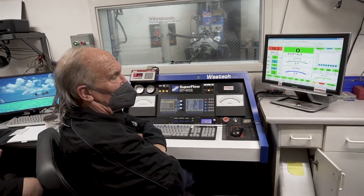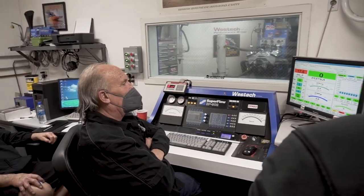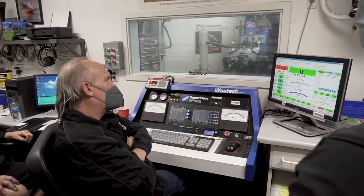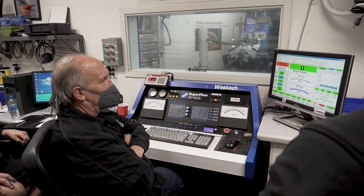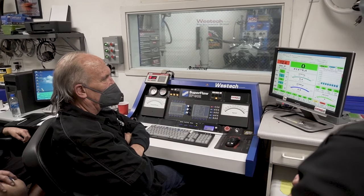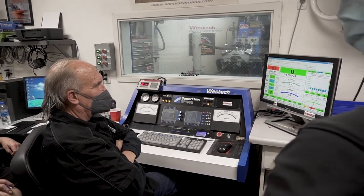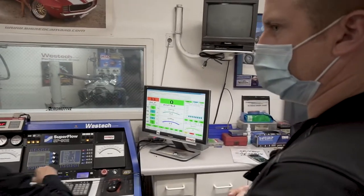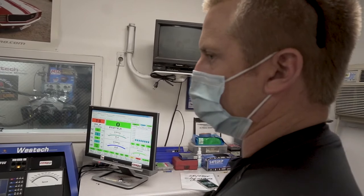So they have to be at exactly the same water temperature to make it a fair comparison. So I would get it down to 124 and then try and rev it to 6,000 and then move on from there. Yeah, 25 horse more. That's good. Out of one little cam change, right? So we always figure for 25 horse. Well, it's a 400 horse small block. There you go.